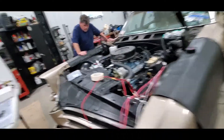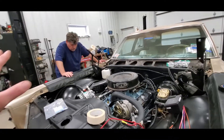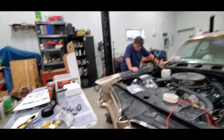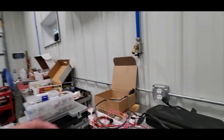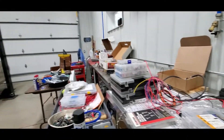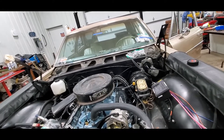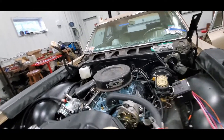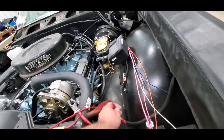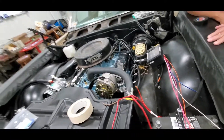We don't know what we don't know yet because we don't have a ton of history with this car. Those are all weekend bolt-on projects — not worried about that. Do remember that we're not doing anything with this until we know the hood clears it, so we're just leaving that alone for now. We can always start it without that. I don't have a ton left on this harness. I just have to set up the kickdown harness which is going to have a relay, and that's pretty much it. I may add another 12-volt power point, and I've got to add the fuse for the subwoofer — that'll be right in there. You want to keep that wire as short as practical.